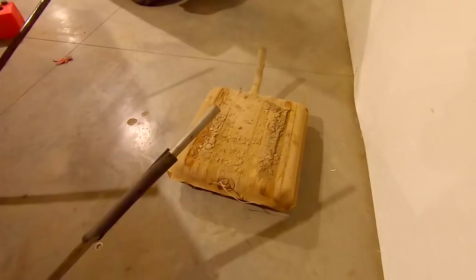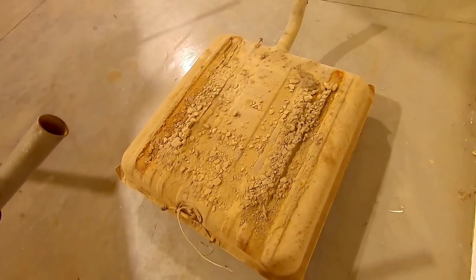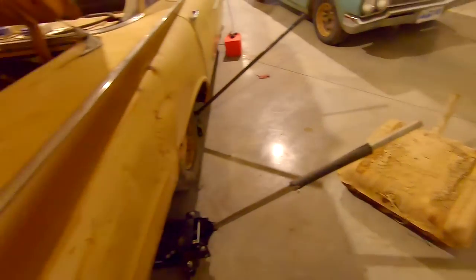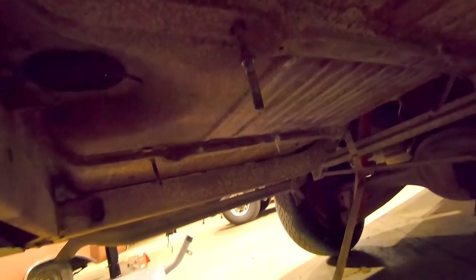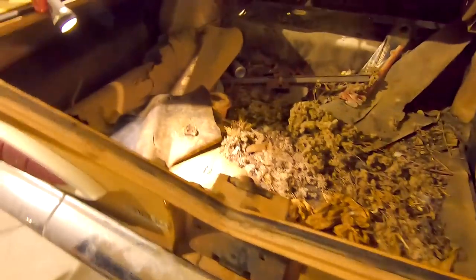The fuel tank is out — and actually it's really solid. It is the nicest original tank I've pulled out of a car. However, even Kansas dry cars still break bolts. As you guys can see, that bolt's not broken but it is distorted. Here's the one I broke. So if they don't break, don't change them, but if they get distorted, it's probably a good thing to address.